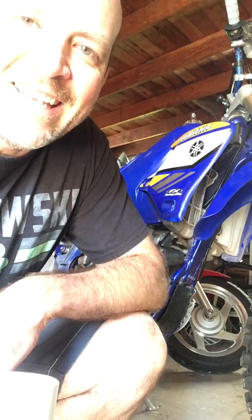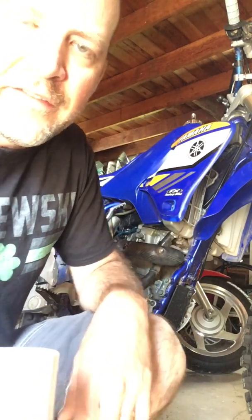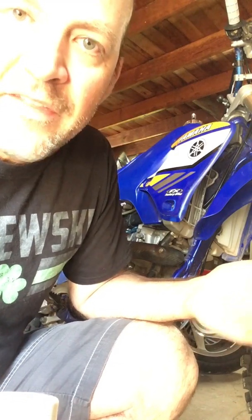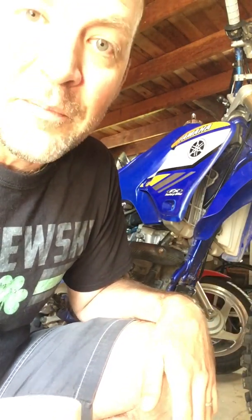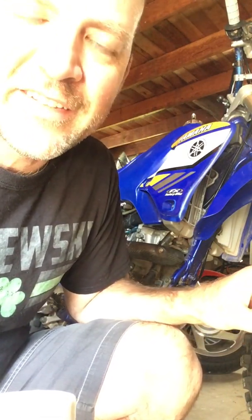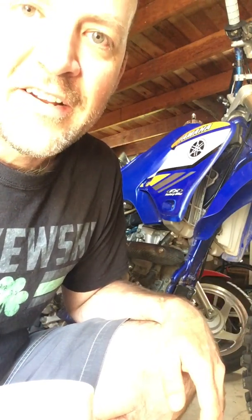The WR250F is an insanely awesome motorcycle, but it gets a bad rap because of this stuff. And my recommendation would be to wait, buy a 2003 and up, then you'll get the electric start. It's all about e-start. When you're riding this thing on the trail and it loads up on you or you dump it, you have to start thinking about the hot start. It can be a real pain because you have to utilize that decompression lever to clear the cylinder. So just know that if you ride this bike, you're going to love it, but when it doesn't start, you're going to hate it.